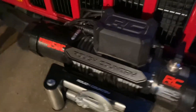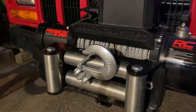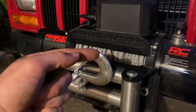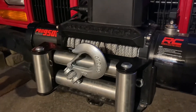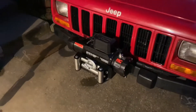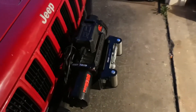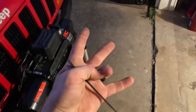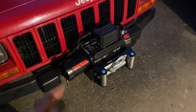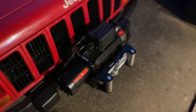You could probably use the fuse between the winch's power and the two different crimps in there — use it before you hit the first crimp, then use a butt splice where it goes straight through from your winch power, to the fuse, and into the splice where all the wires come together. That's it people — just a quick little upgrade you can do for just about any winch, as long as it's a simple three-prong design like mine, or possibly even a four-prong if it's got a ground, a power, and the two directions forward and reverse.